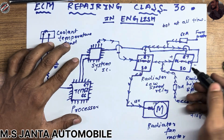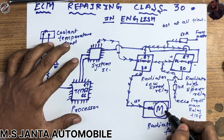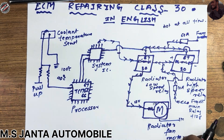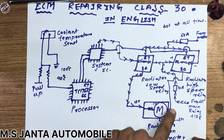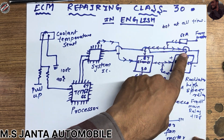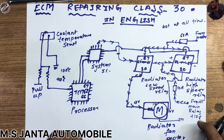Pin 30 travels from here and goes directly to the motor. The ground is constantly connected — it connects directly, not via a relay. So when you supply low voltage it gives low speed, but when you connect here there is no resistance between the motor and the relay. So the full 12 volts reaches the motor and it runs at full speed.